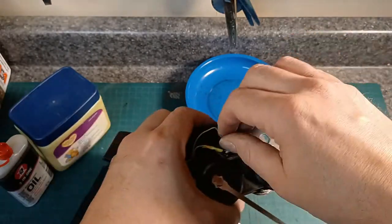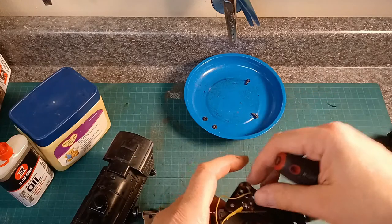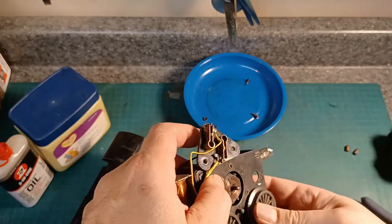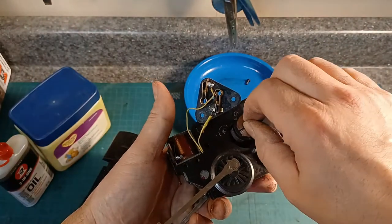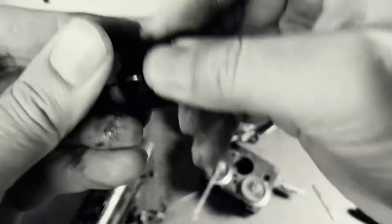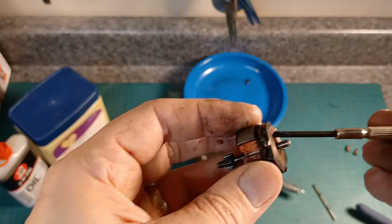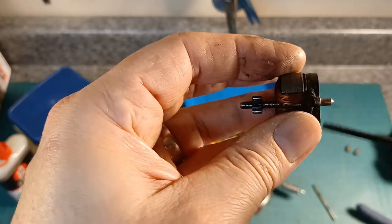There's one — and that's it. Now this will just lift up. There's our armature, there's our brushes. So this one could use a little bit of cleaning. Now that you get the plate out of the way, the best thing about the 1130 motor here is you can actually lift the armature right out, so you can work on it much, much easier. Perfect. Now let's get my eyeglass screwdriver here. There's really nothing in those slots, but just to make sure, give it a little extra help there.